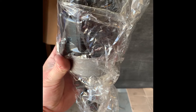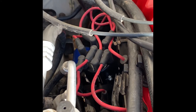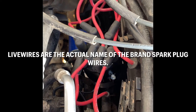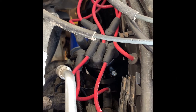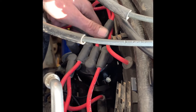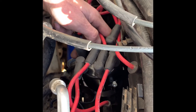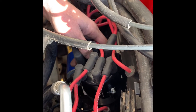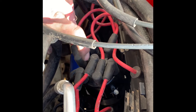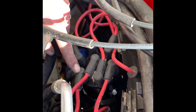In this video we're going to show you how to properly install a new distributor. We have old spark plug wires here — we're going to replace these with live wires. We had a small discrepancy when starting the engine after putting the motor together because of how everything lined up. So we're going to go over exactly how this distributor lines up in the correct orientation so you don't have the same issue. This plug wire right here is number one — timing is always based off of your number one cylinder.